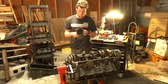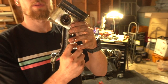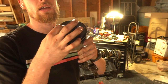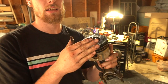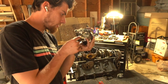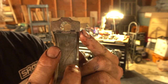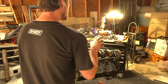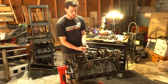We're for sure getting new ones now. Here's your piston — this is what a piston looks like. What makes this specific for diesels is this giant cup here, which gives it more compression. A lot of gas motors are flat or will have a slight hemisphere or design on them. We can see scoring underneath — it's not the worst thing ever but it's not the best. On one side there's a chamfer, which is kind of like a 45-degree cut. You can see this side is more chamfered than the other — that's very important. The side that's most chamfered is going to face the cylinder wall.